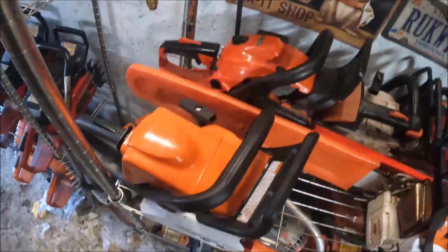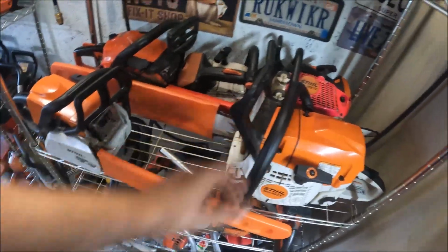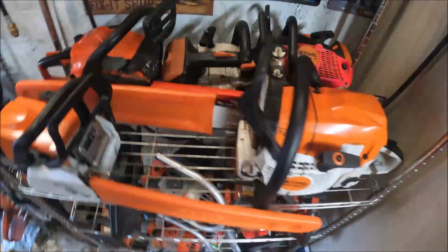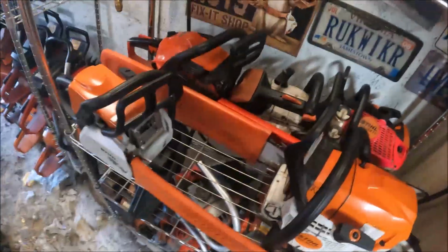And then this is one of my favorite builds, the Echo 4910. It was a kind of a low roof, short blowdown build. It seemed to really like it. Believe it or not, I don't know about now with the air filter, but with just the bark box on it, this saw would hang right with this one, and it has like 9-10 cc's on it. Probably faster depending on what wood you was in, because I've got that saw tuned at 15 grand. It has a low exhaust roof, if that tells you anything. It's fast and has a shit ton of torque for a 50cc build.